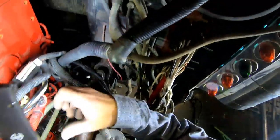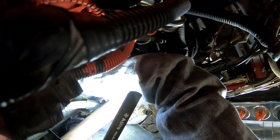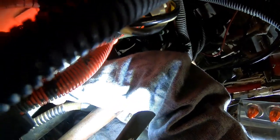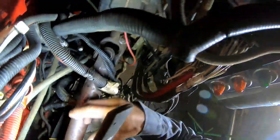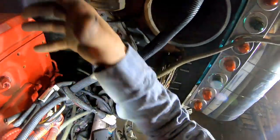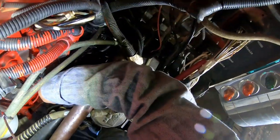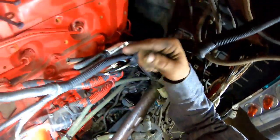On the newer trucks there's a little box with a mega fuse - it comes off the battery with a mega fuse for the alternator. This one has a circuit breaker on it. I downloaded a wiring schematic for this 1995 and this is the circuit breaker for the alternator, but it doesn't tell me the amperage. Hopefully this alternator doesn't put out so much current that it trips the breaker all the time. I decided to do away with that box to simplify things and clean things up.